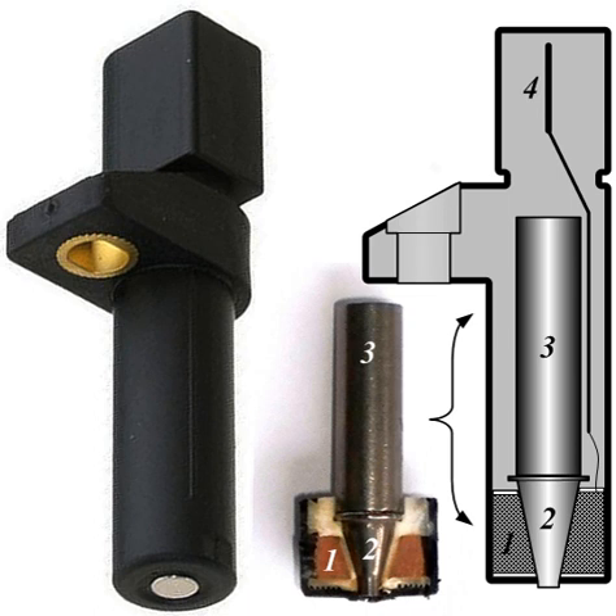There are several types of sensor in use: the inductive sensor, Hall effect sensor, magnetoresistive sensor, and optical sensor. Inductive sensors have the simplest construction and are usually purely passive devices. Hall effect and magnetoresistive sensors have the advantage over inductive sensors in that they can detect static magnetic fields. Optical sensors do not have great resistance against fouling, but are able to provide the most precise edge detection.